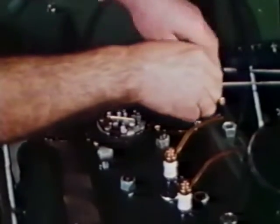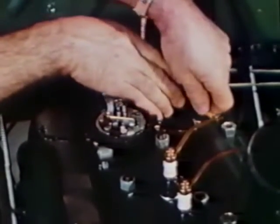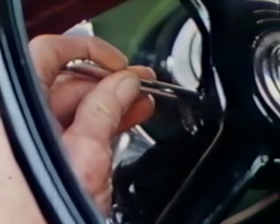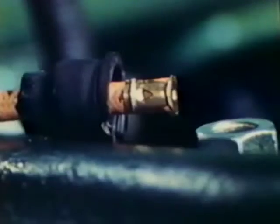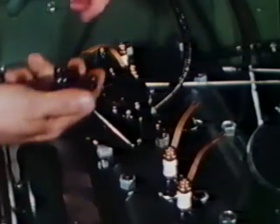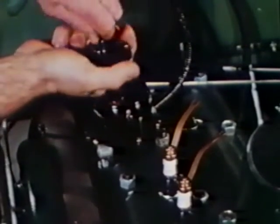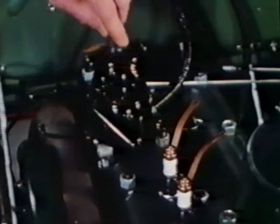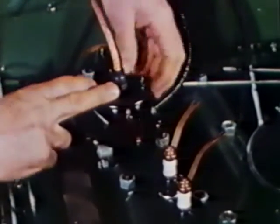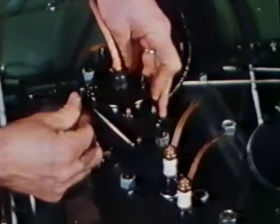There's an easy way to check our work, and we should do it every time. Lay the high-tension coil wire within a half-inch of a ground point, like an engine stud. Turn the ignition on and slowly pull the spark lever downward. Our spark from wire to stud should occur when the lever is about a quarter way down the quadrant. That's the operation — about 20 minutes work for an average guy. Six simple steps. Let's go back and see just what we've done.